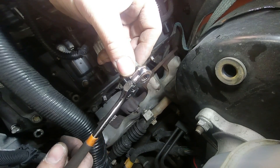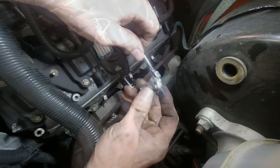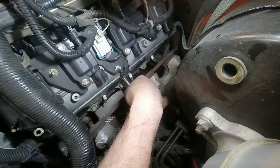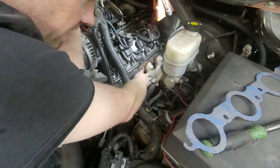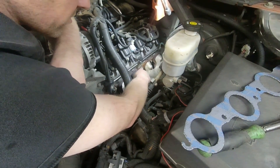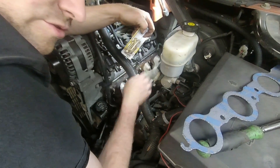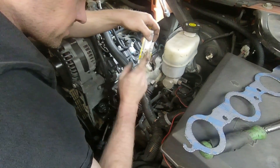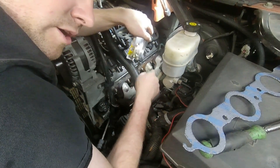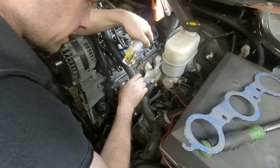There it is — you can see how far it was sitting in there. I'll put it between some vise jaws and hit it with a punch and it'll come right out. Now I can clean up these surfaces and put the gasket on. You can see the shiny new bolts — don't forget to properly torque those down. Here is the new bolt set — this is from Dorman, I'll throw a link in the description. It fits pretty much any LS-based engine. Note: these have 12mm heads whereas factory bolts are 13mm, but they're nice and cheap.